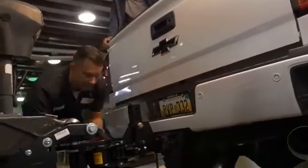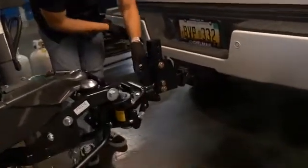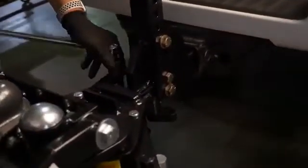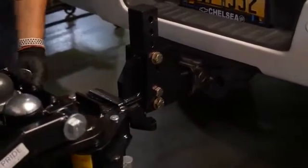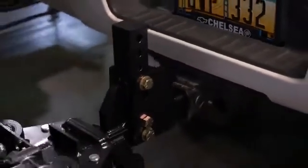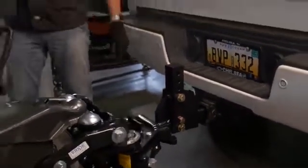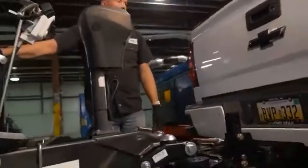So at this point we can take the over-center latches and undo each one just like that. And honestly, anytime you have these latches on you should really just put your linchpins in there — we did not do that at first, but just get in the habit: anytime you do these latches, pop that linchpin in there so you know it's on there and it's not coming out. These constantly have back pressure on them so it's probably never going to come off, but definitely utilize those linchpins.